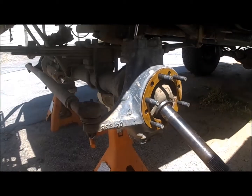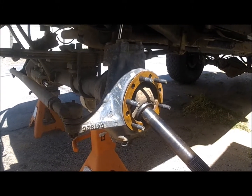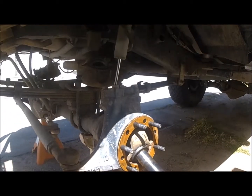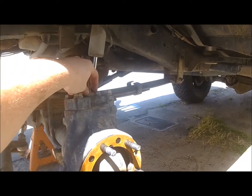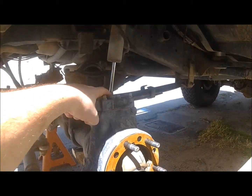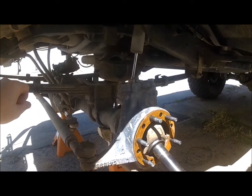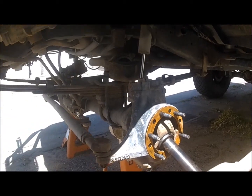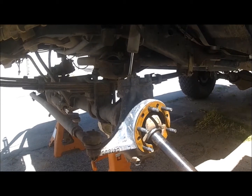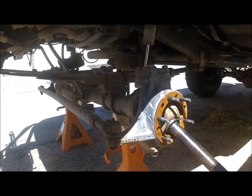You've got to take off the steering linkages so that you can rock it back and forth and feel for slop. There's a better way of doing it — it has to do with putting an inch-pound torque wrench either on here or down here and actually feeling what the resistance is; it calls for a certain amount, though I don't know what it is. I just kind of do it by feel and it seems to be working okay.